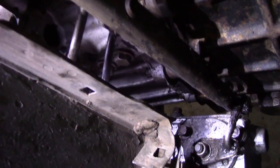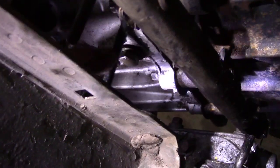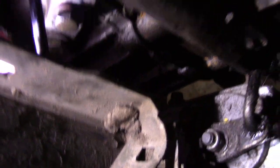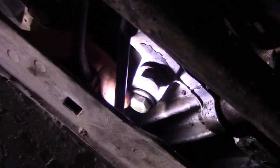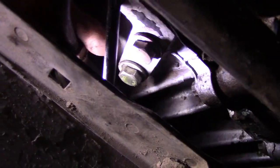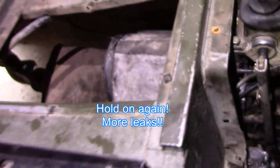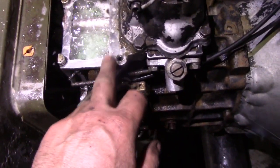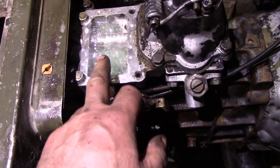Let's go and have a look at the gearbox we're putting in. If I try and shine the light on those two bolts you'll probably be able to see them - there, one there and one at the back. Pretty hard to see, not too bad to get in. So I put a steel washer on and a copper washer behind, and now we'll test it again.